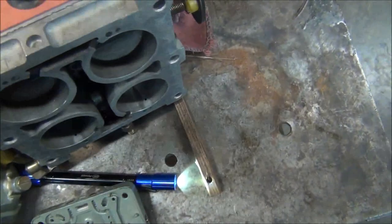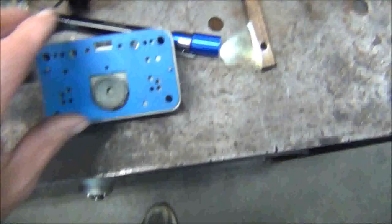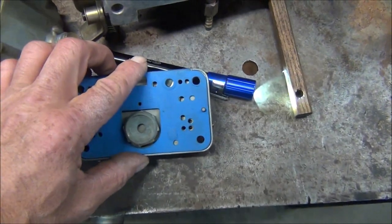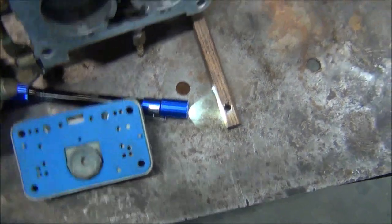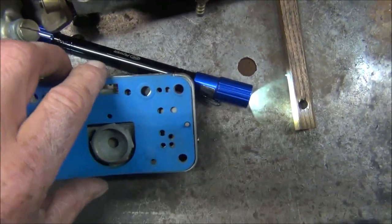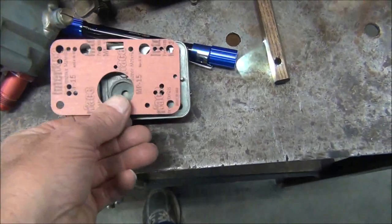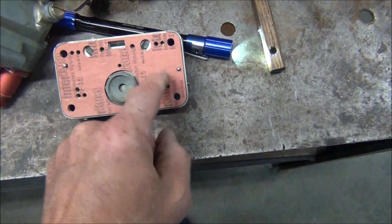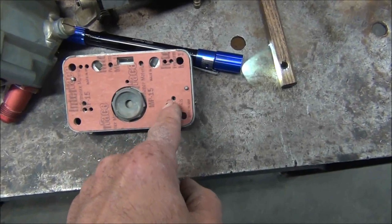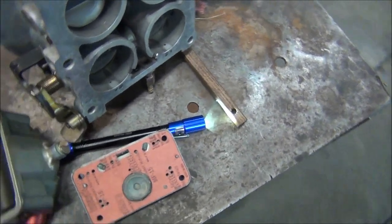And I also noticed it shouldn't matter, this old gasket here. If you see, of course, this hole and that hole lines up. But you got these two holes here, which really go to nothing, so those two extra holes should not matter. But this here looks like, yeah, it blocks off all that slot and it only lets fuel or air, whatever goes through there, through these holes. So yeah, I think we finally got the correct gaskets for this carburetor.